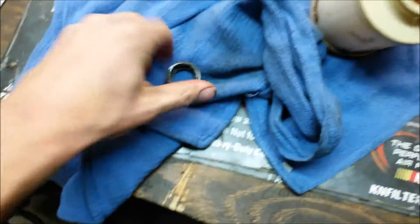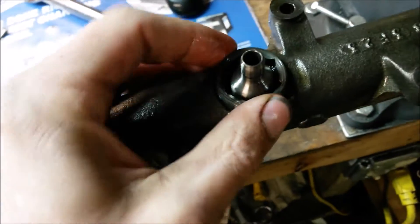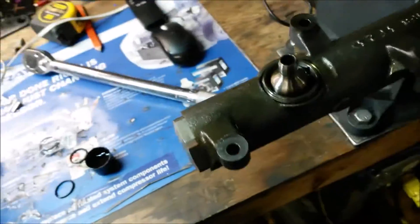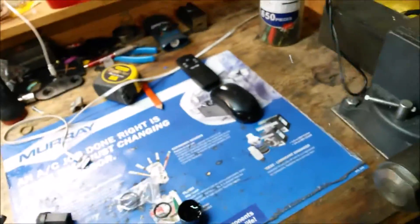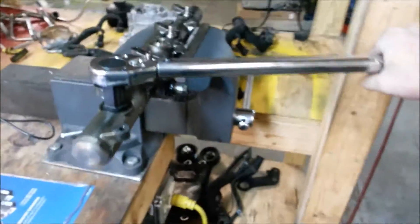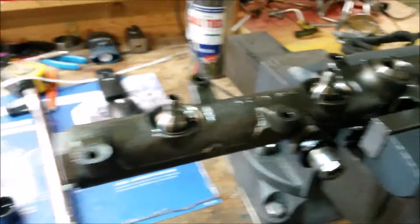Make sure your lock nut is nice and clean. We do recommend hand tightening these — you want to hand tighten them and torque to 100 foot-pounds. That's it. There it is — the new HHC Diesel black oxide coated, half inch drive nipple cup O-ring remover socket, and we just fixed this oil rail. That's the perfect thing to do.